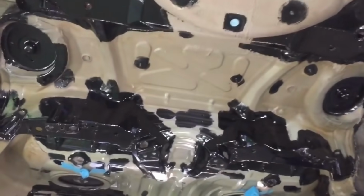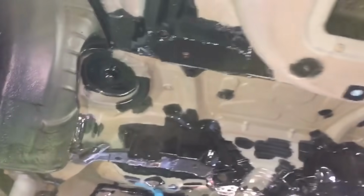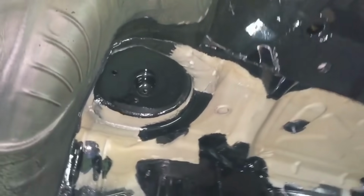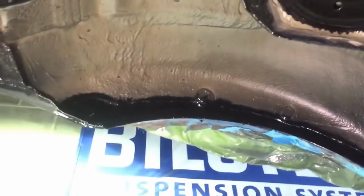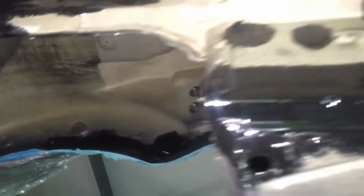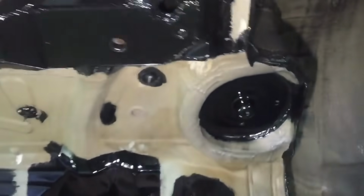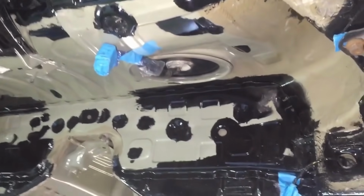So you're looking up at the rear axle carrier panel, where the reinforcement plates are, and then into the wheel arch areas. Found areas of corrosion up on the rear arch wing areas on both sides. Removed a redundant battery box bracket for 330 models. Spring perch areas, then moving into the fuel tank areas.